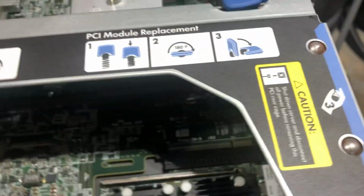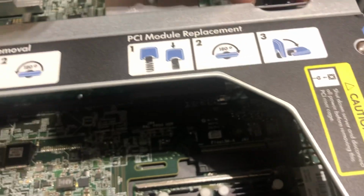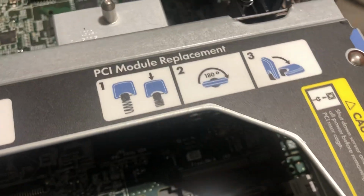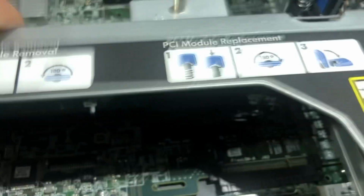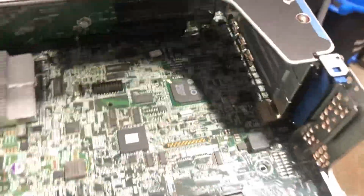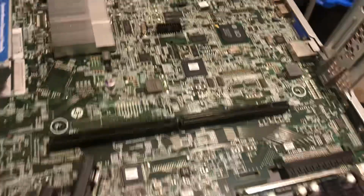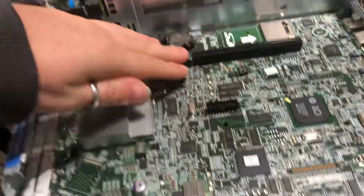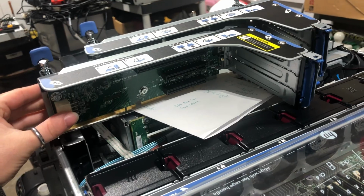So coming over here, if I'm going to take out the riser slots, we can have a little more in-depth view of what's in here. Riser one goes, and riser two goes. These are not standard PCI Express slots. Please do not connect anything directly into it. You require the risers absolutely.